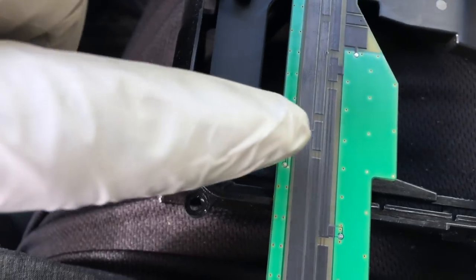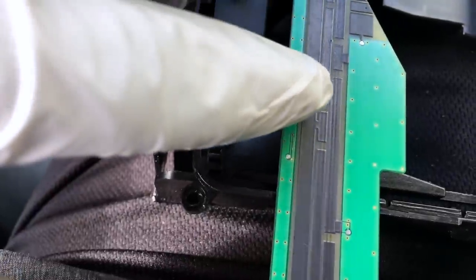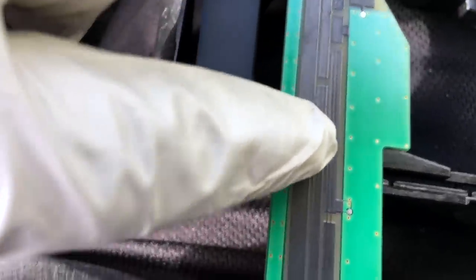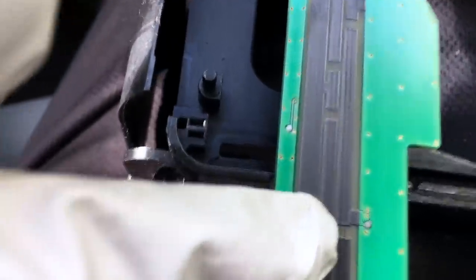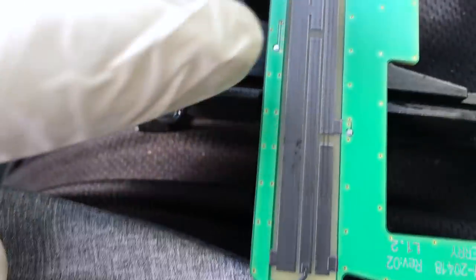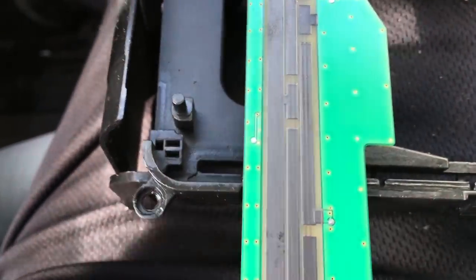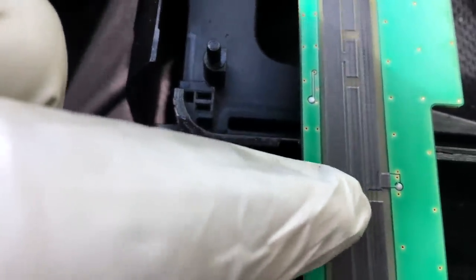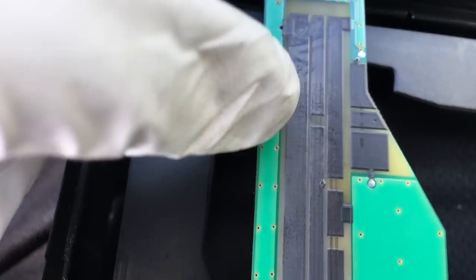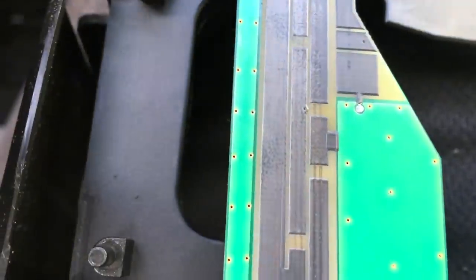Here you have your park position, here's reverse, neutral, and drive. You can see the graphite trace issue — that little track line right here has crossed over where it's supposed to be clean. You've got those two little trace tracks bridging together. You're going to want to get contact cleaner. Spray the Q-tip and clean these as good as you can. You want all that graphite to come off — it should be a single clean space, not tracks running through it. See the trace amounts right there — that track is supposed to be completely clear. That's the problem.